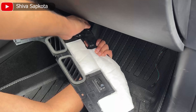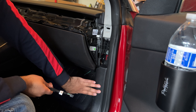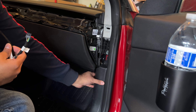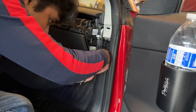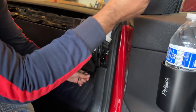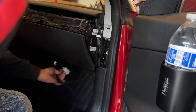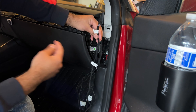The speaker plug can be disconnected by simply pulling on the plug. Now that we've removed the glove box panel, for Intel versions we don't have to remove the side door panel — all we have to do is route the cable towards the top. For AMD that's also true, but we still have to remove the panel and make those two connections. For Intel, go ahead and pass the cable through the bottom. Leave a decent length for the plug connection, and this will reach all the way to the top.